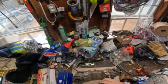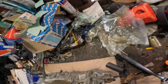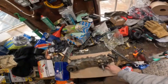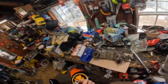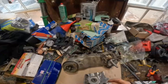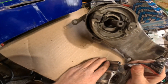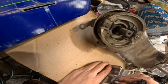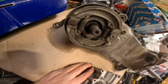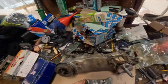Look at the other side all ready. So we're gonna take this side here and Honda Bond all right here. This is two different engines, so I gotta pull this dowel out, right here like so. And this dowel - we're gonna leave this dowel together. So the greatest silicone Honda Bond. It's cold as hell, so it's gonna be a little slow moving today, just like me. Just doing a skim, we're not doing anything crazy. And if we have to add some, we'll add some. Now without the dowels here, this is nice.